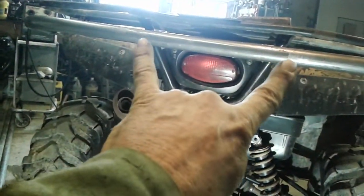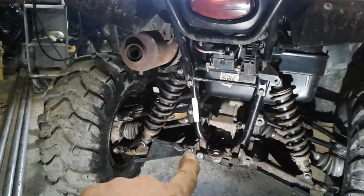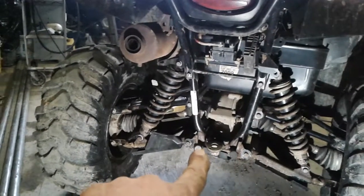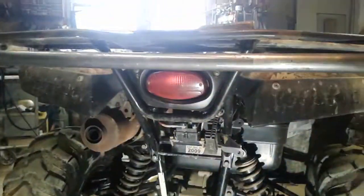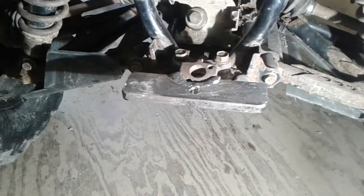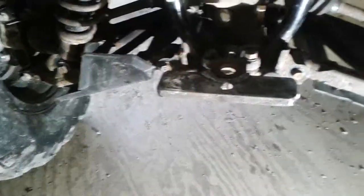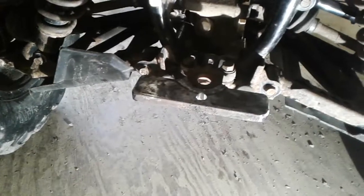What I'm gonna do is tie in here on two sides, kind of radius it out, and then down here where the hitch is, I'm gonna put a steel plate. I got a piece of half-inch steel plate that's gonna get welded right directly onto that hitch, so that it can be unbolted from the frame. There's the mount for the connection to the roll cage - that's half-inch steel. I left room for my ball to go back on there, and I also got a hole because I always put a clevis in there to put a strap on to pull other people out.